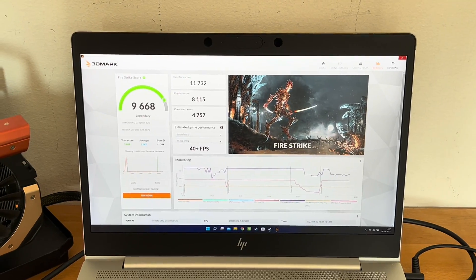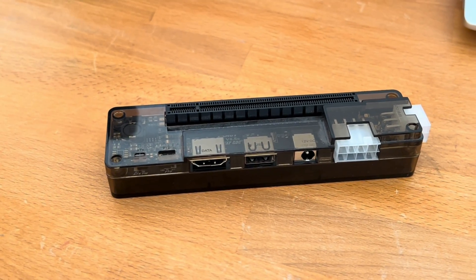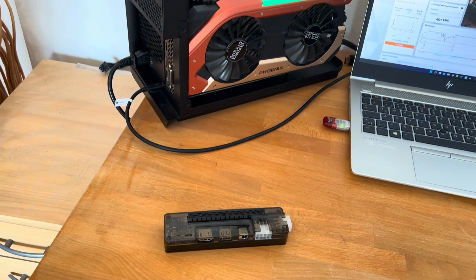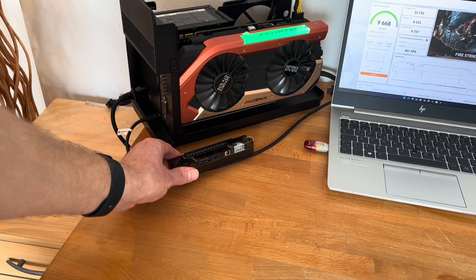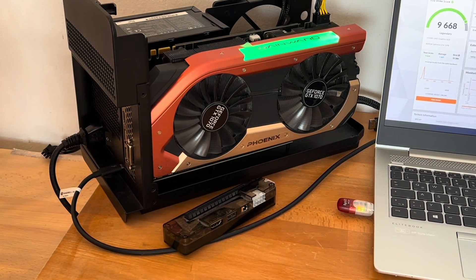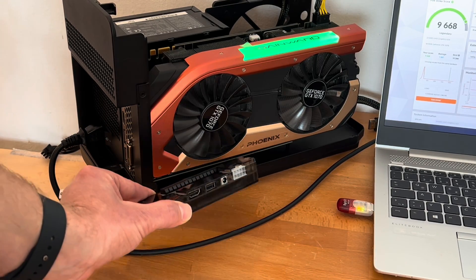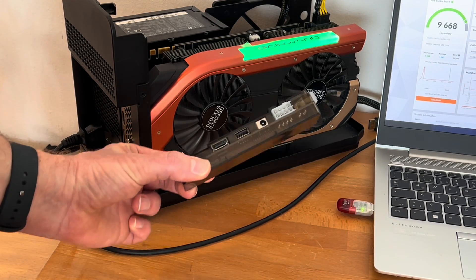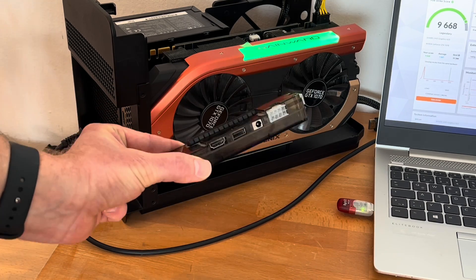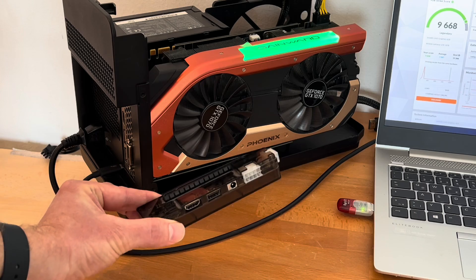That's why my personal favorite is the USB-C version, even though the EXP GDC module is much cheaper. For someone who has a simple laptop and just wants to make it gaming capable, the GDC variant is definitely enough to set up a simple gaming system really cheaply. However, what you need to know is that only older NVIDIA graphics cards work with the GDC module: the GTX 900 series and from the 1000 series the GTX 1060, 1070, and 1080. The 1080 Ti does not work, and all RTX graphics cards do not work either, meaning no RTX 2000, 3000, or 4000 series.